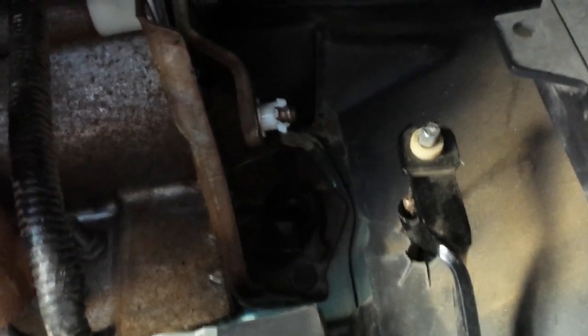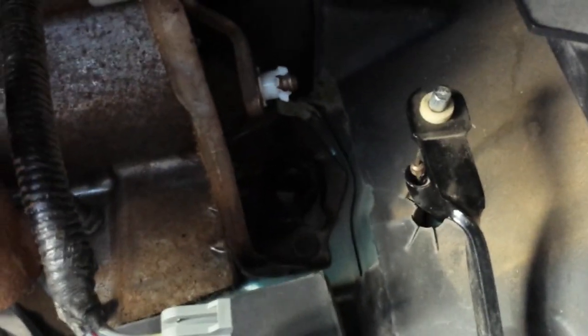And you got to bleed the system. So why do the job twice? If we're going to be taking things off, we might as well just change them out and be done with it, is the way I see it. So I didn't have to change the external slave cylinder, but I figured it would be wise since we plan on taking it up in the mountain soon.